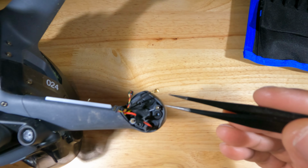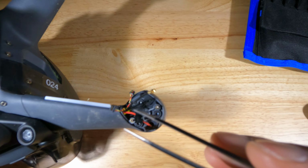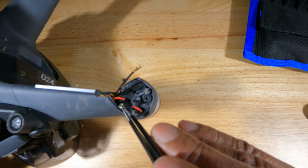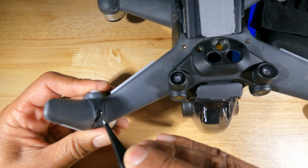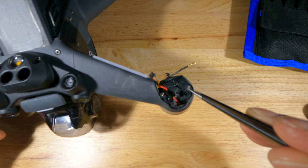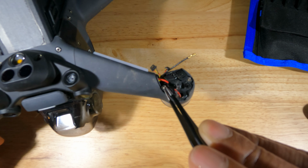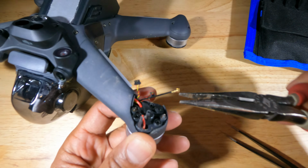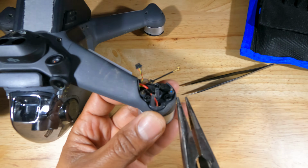Back at the shop, my detailed inspection reveals that the antenna connectors are still connected. However, the screws for the mounting arms, as we can see in this one, the heads have sheared off, so first thing I need to do is extract the shafts of the screws. So to do that, I'm going to use these needle nose pliers. Get a grip and unscrew these.